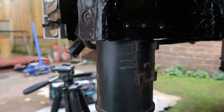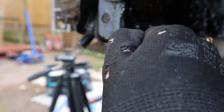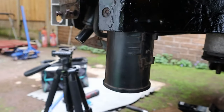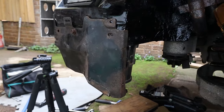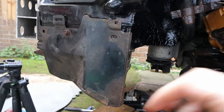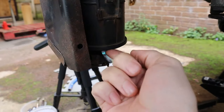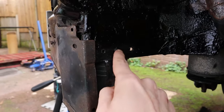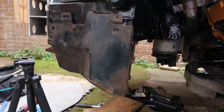As you can see now with the cover on, I bolted it up there. It basically sits on the bottom of this anyway, so one good circlip there and that'll be alright. I just think I need to now scrub this down, sand it up and pour it on. I've removed all the rust off it with a cookie wheel. Now I'm gonna etch-prime all that bare metal and then spray it black.